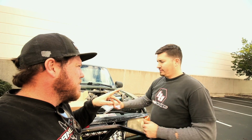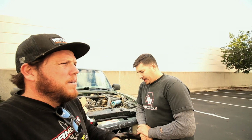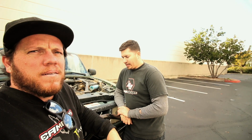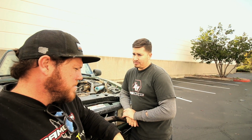I got the wiring harness. Yeah, so you got the wiring harness that will run 2 lights, and that's at your house, so we're not going to do that today. But, you know, we would prefer that on these lights in particular, because they're about 10 amps a piece, which is quite a bit of juice. Your HIDs were probably 3.5, so we're going up almost 4 times per light. Okay.